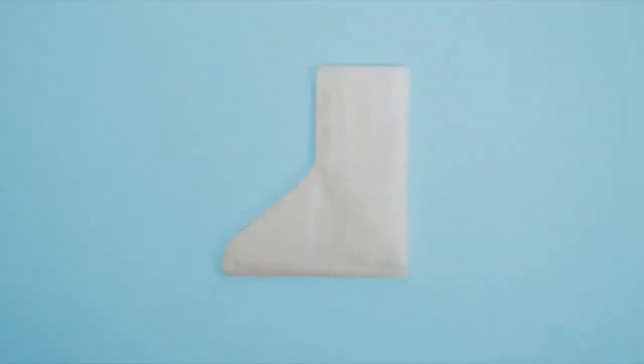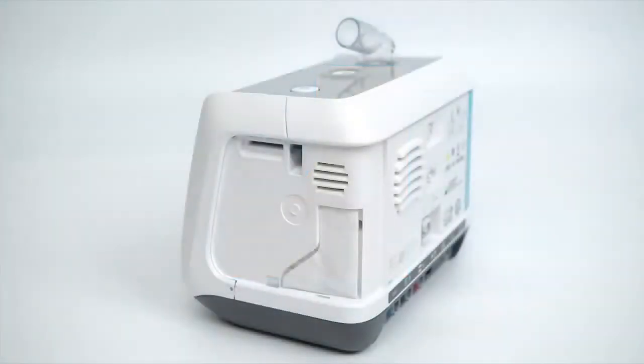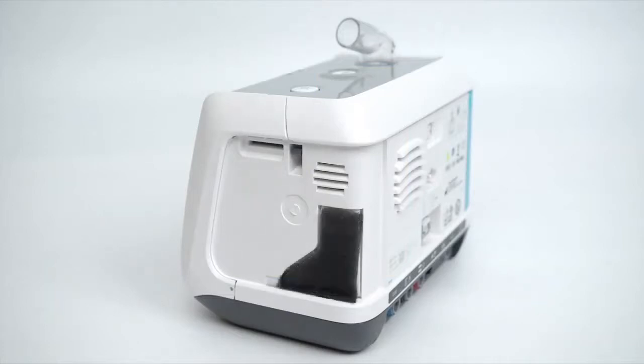The white inlet filter is for filtering small particles. It is recommended that the filter be changed at least every 30 days or more frequently when used in high pollution or pollen-rich environments. The white filter should be inserted first over the air inlet, with the black filter positioned as the first point of contact for the air.